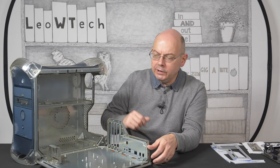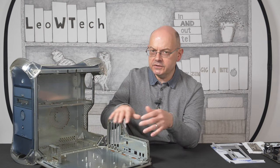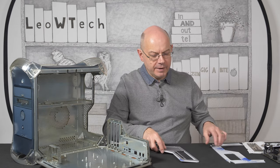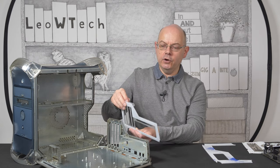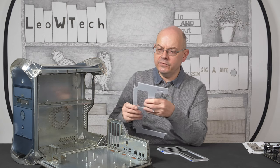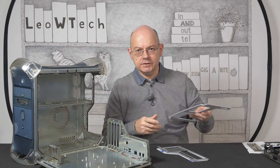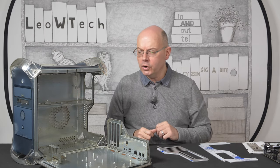The original Apple layout has the motherboard on this door here. The IO panel is there — it's fixed in place, so I've got to remove that. I've bought some hardware from LaserHive. They make this nifty conversion kit: that's the replacement IO panel, and here we have a replacement panel for the power supply side of things. It's built to accommodate an SFX power supply because I want to use a small power supply to give myself the maximum amount of space to work with.